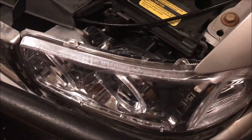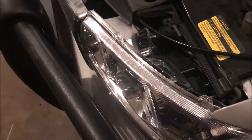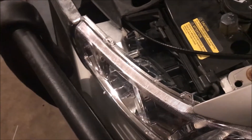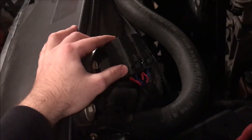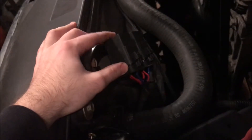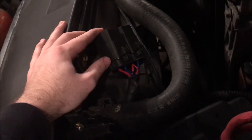Once you get your headlights put back together, just install them — all it is is this pin right here and this pin. I won't show the wiring; it's pretty simple. All the lights plug in only one way so there's no way to mess it up. You should get a relay kit — I bought this with a different kit and reused it, but for these HIDs they suggest a relay kit so you get a dedicated positive and ground.